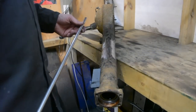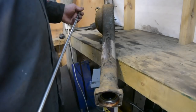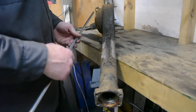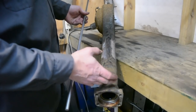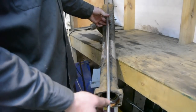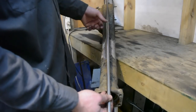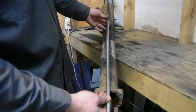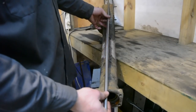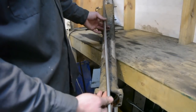I just wanted to try and explain a bit better about getting this casing right, or how you can get it wrong and what sort of effect it will have. Now, what I was saying about the difference between cutting it here and up there, the way I see it is if I cut the end off here, shorten it up and weld it back on, if you imagine this piece of steel is the axle, if I shorten that up and get it out of line ever so slightly, which is probably not actually possible with the system I'm going to use, but if you didn't have any system, if you just tried to line it up and you welded this on crooked, what you'll find is the axle would want to be pointing out here or out there or up or down. So if you had that and you'd welded it up and then you went to slide the axle in, you'd have real trouble trying to get the end to engage into the diff head.